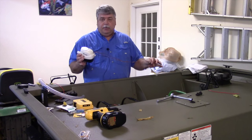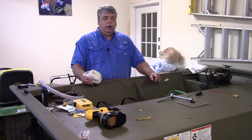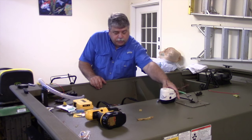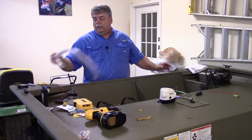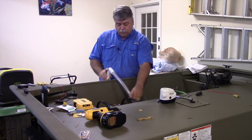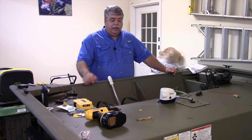I'm going to put an automatic bilge pump in since this boat sits in the water a good bit of the time. The automatic bilge pump will come on anytime it gets enough water into it, pump it out, and keep it from filling up while it's unattended. One issue with this particular boat is that there's no exit hole for the bilge pump to pump out of. So what I've done is taken some PVC and made a U-shape that just fits over the transom, gives it a nice clean look, and it'll sit there all the time with the bilge pump holding down the other end.